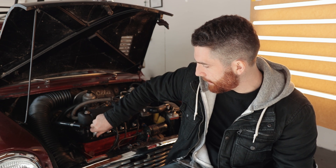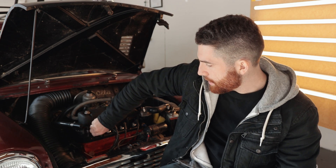Now, let's say you have spark going to the end of the lead and your spark plugs are new or look in good condition, but still not firing. One thing it could be beyond that is your timing being out. If your timing is out enough that it's not coinciding with the rotation of the engine, this will cause a no-start. It'll actually be sparking, just not at the correct time. From there you can go to our timing video, link below, and start checking for timing.